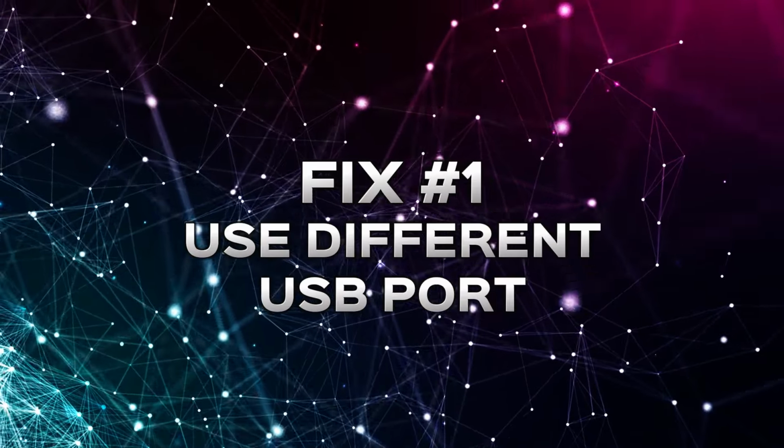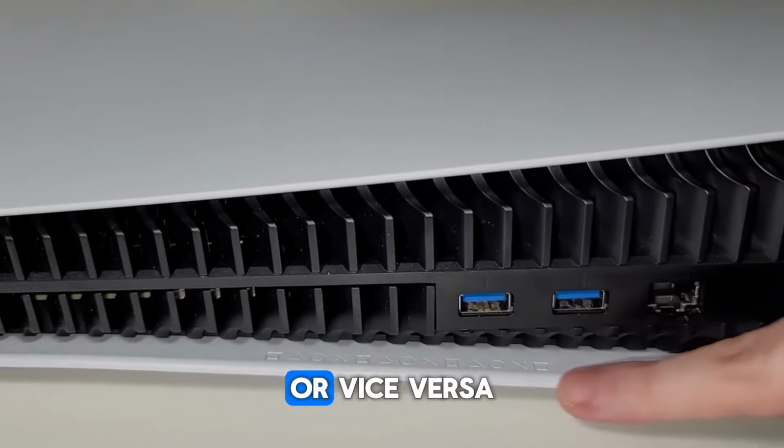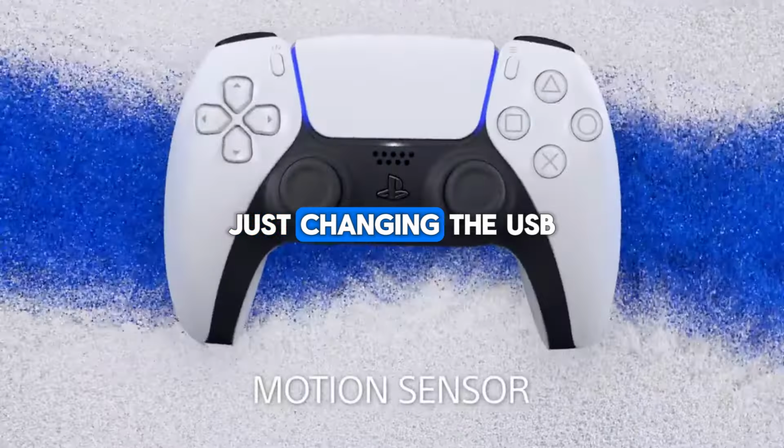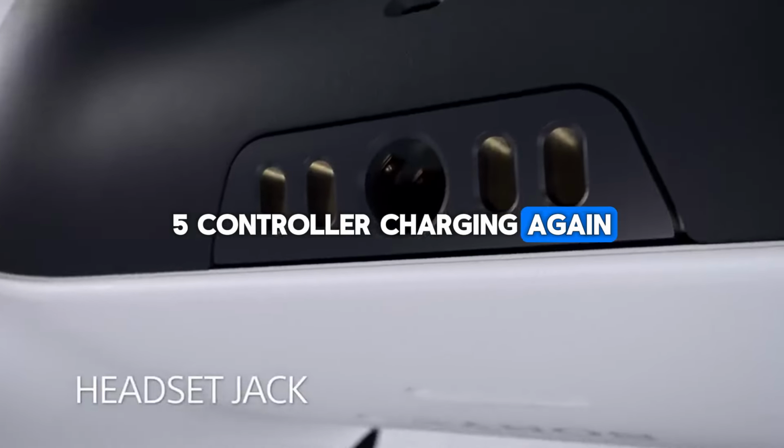Fix number 1. Try using the USB port on the back of the PS5 console, instead of the front, or vice versa based on where you had your PS5 controller plugged in, as sometimes just changing the USB port you plugged into may get your PS5 controller charging again.